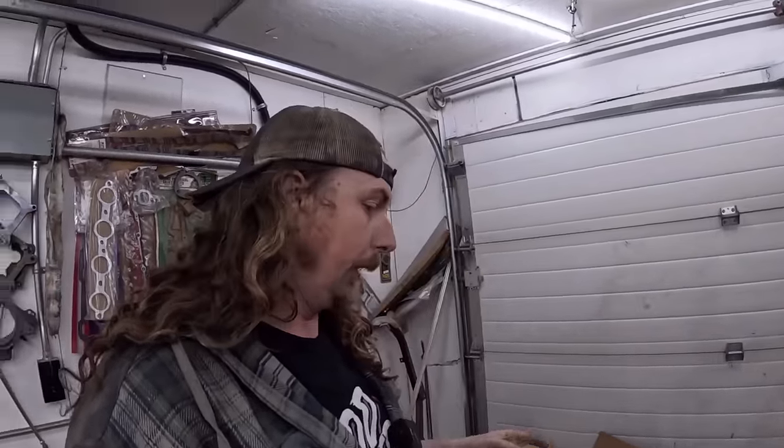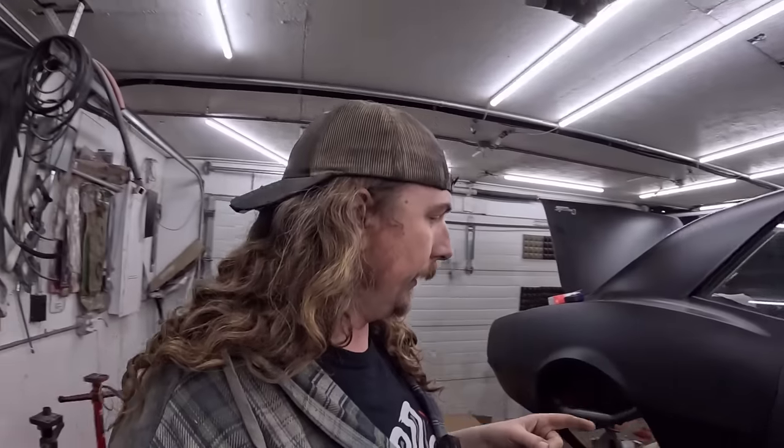When I was under there, I measured 49 and 1/2 for a driveshaft. I Googled it — I think this is a factory Camaro driveshaft. It says the length is 49 and 7/8. Unless it's a big block 4-speed, then it's actually longer. I guess they must move the motor ahead or something.